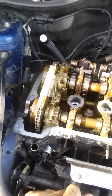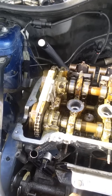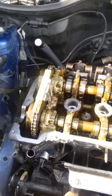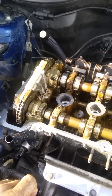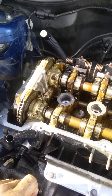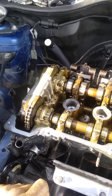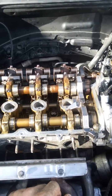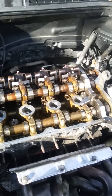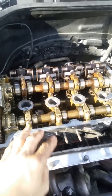If you're really lucky like I was, you can reuse your pistons. I did have a pinched piston ring, so I had to clean up and file the ring groove because it had been hit so hard so many times by the valves that the top ring groove on number four cylinder was pinching the ring. I bought new rings and just changed those.